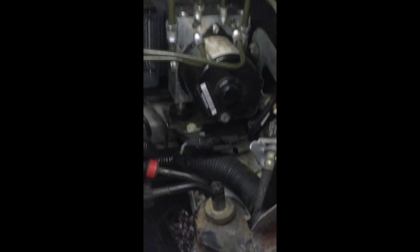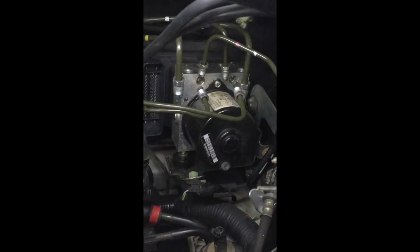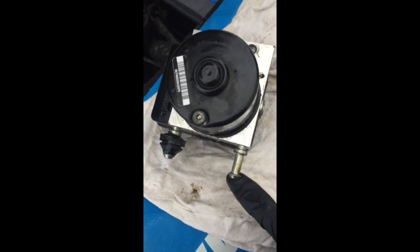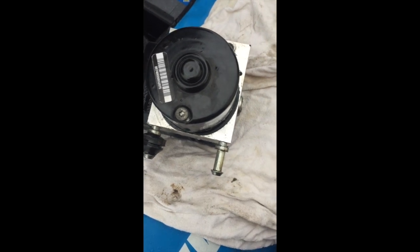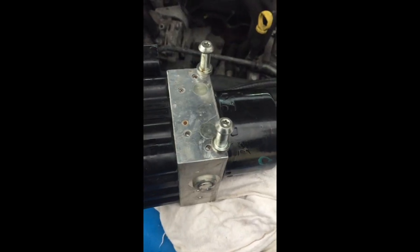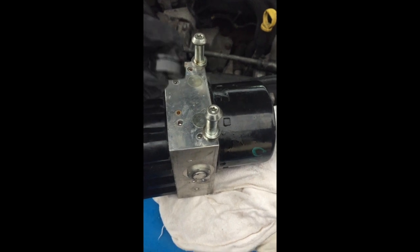The attachment that sits in the side of the pump and holds it to the bracket is a 12mm bolt. Just in the middle of getting the pump out — one of the lugs has raised out but the other is proving a bit tricky, so just giving it a lever with a bar. This is the old pump removed. We lost one of the bungs in the fight but the new pump has more, so it's not a big deal — just pull them out. Having a bit of trouble with the studs underneath; the best way is to get the bung off the stalk and then put it in place in the bracket first.